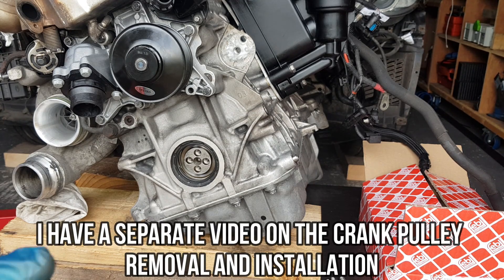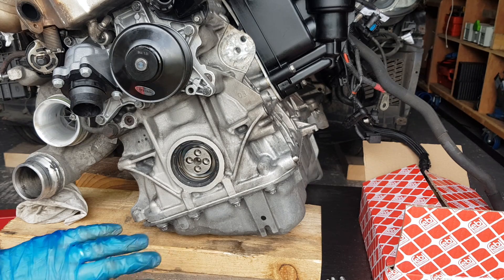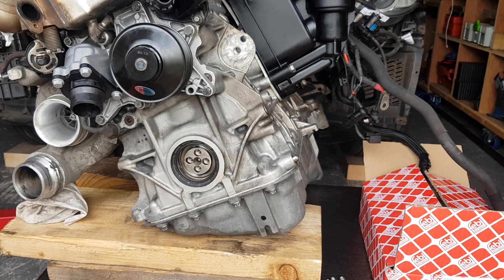Now we can install the next component, the crank pulley. As you've seen, it's super easy. I didn't have to use any special tools — as long as you have your shims and a sliding hammer to pull it out, it's as simple as that. Don't overcomplicate it, don't buy any special tools, just use your common sense. If you like this, hit the thumbs up and subscribe. I have a ton of BMW N57 videos and a lot more to come — I mainly work on BMWs and German cars. Hope you enjoy this and I'll see you in the next one.